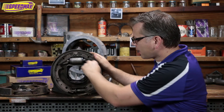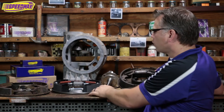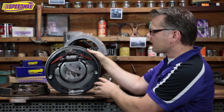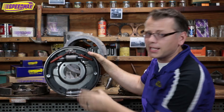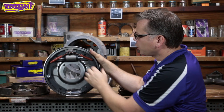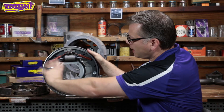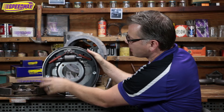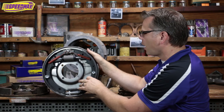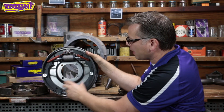And you can see it's got a lot more parts to it — a couple extra springs and an adjuster down at the bottom. So this worked really well. I'll talk about what self-energizing is with this 39 Lincoln style brake setup we sell here at Speedway. You install this on your car, and the reason why they call it self-energizing — generating its own power — is because as you're driving and you apply your brakes, the cylinder is going to push your pads out to make contact with the drum. As they do, this thing starts to catch and then it rotates the whole assembly. You can see how it pivots up here on this one pivot point. And then as it starts to catch, it drives this bigger pad into the drum itself, creating a lot of force on that drum that typically wouldn't have been there with the old juice brakes and the fixed pivot point.